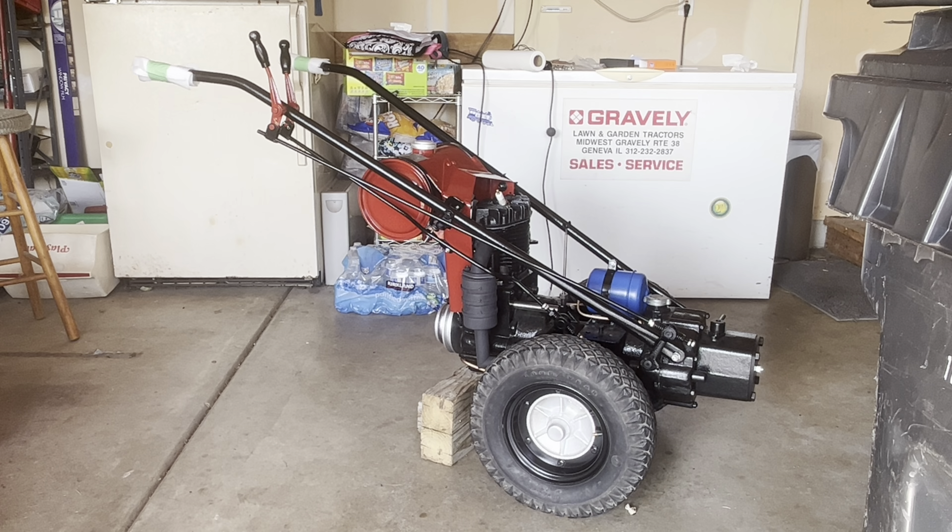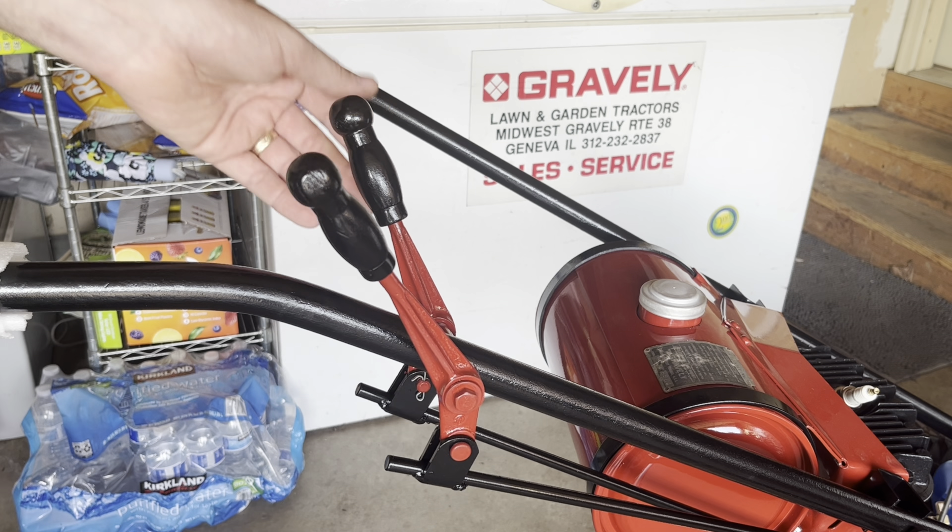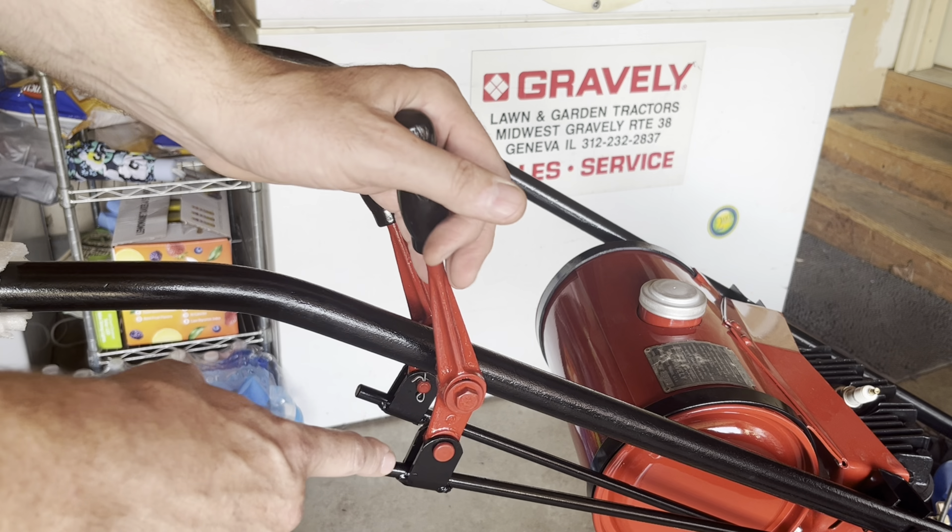Let's take a look at the different mechanisms, how they work together, and what we need to adjust. On your right side handlebar you'll notice you've got two shift levers. The outboard one is your forward-reverse, inboard is high-low. How these work is if you move them one way or the other it's going to push or pull this rod, and they lock into place by literally camming over center and snapping into place. The other end of the rods that attach the shift levers have a threaded section and four jam nuts to control how far this clutch lever is going to move back and forth on this rod. The near one is your high-low, the forward one is your forward and reverse.